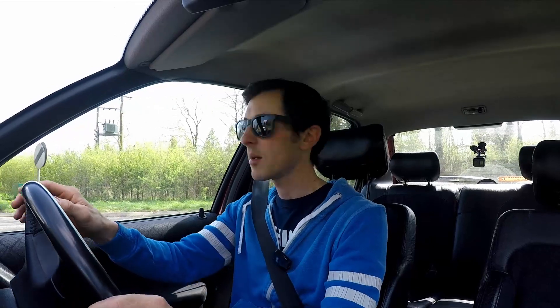I wouldn't recommend more than 50 percent. The old engines — like the 1.9 XUD — you could put 100 percent veg in and be fine, but they're not many around to find anymore. I know some people are considering swapping those engines into these later cars — fine, do what you like — but for these 2-litre HDIs, keep the limit in mind.